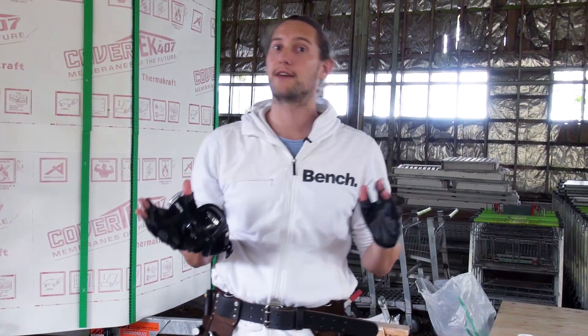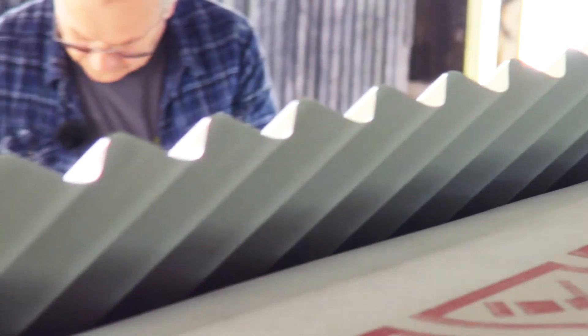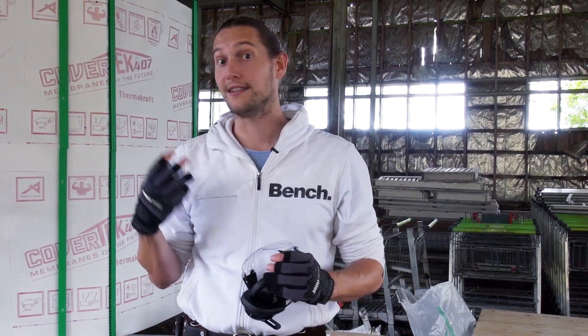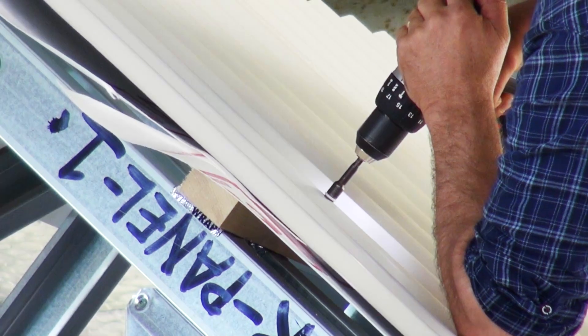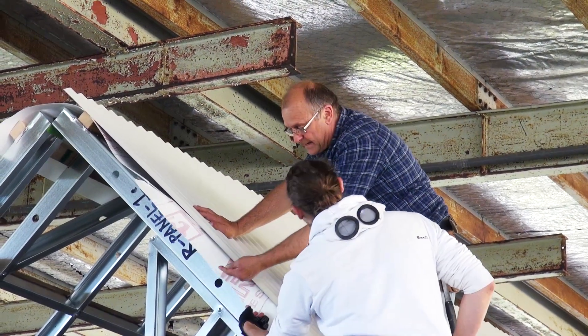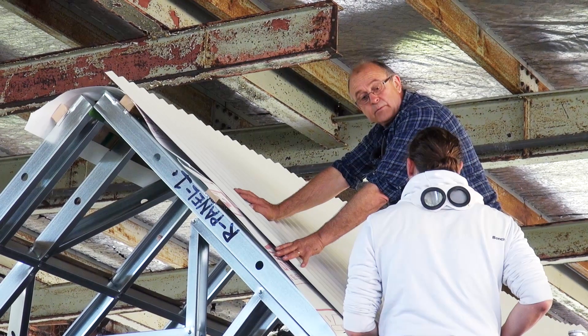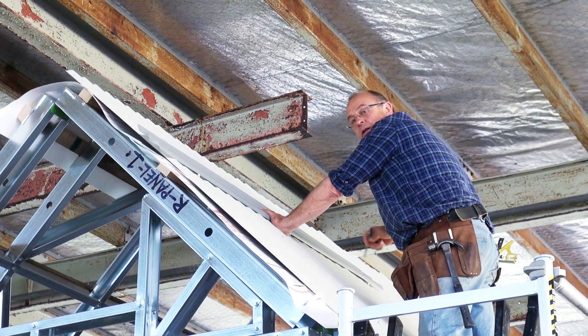The whole way along this build we've been really careful to make sure we're not exceeding the maximum dimensions for a light simple trailer, and one of those dimensions is of course the height. There are a lot of things that go into making up the height of your trailer — it's not just the framing. There are multiple different levels: on top of the frames we've got the purlins, then the roofing, then the ridge cap. It's a good idea the whole way across the build to keep monitoring your height and make sure you're within those legal limits. I could use a piece of string, flick a chalk line, or use a straight edge — I'm just marking where my screws are going to go to screw the roof off.